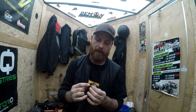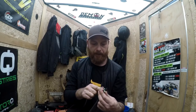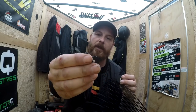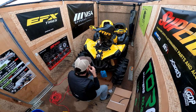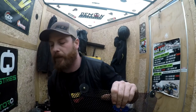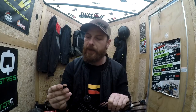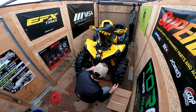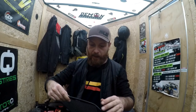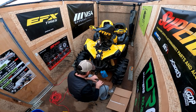Pre-screen. You're gonna feed the nut and washer through the screen, through your spacer, and then you've got these little rubber guys, which are just a bit tight and small, and that's gonna hold all your hardware in place. You've got little slots here you'll see on the rad for these. Then you're gonna feed this stuff alongside. Okay, use the other side as well.